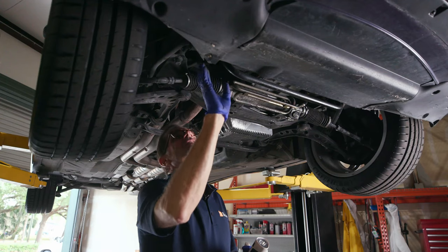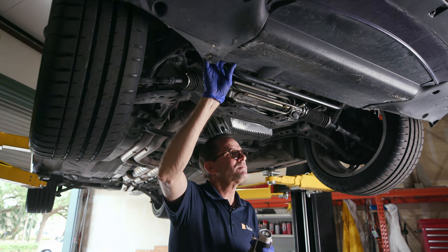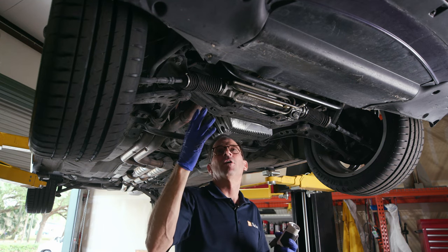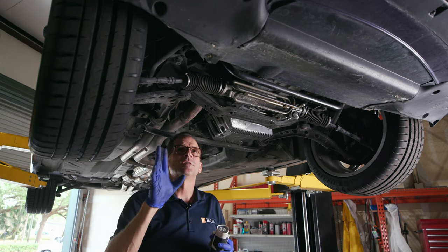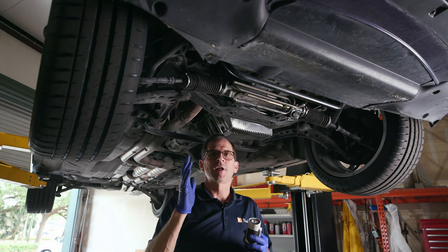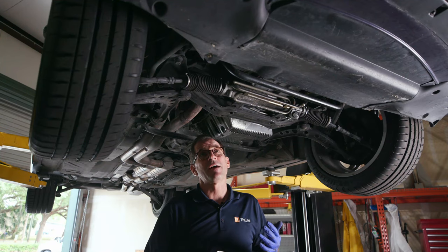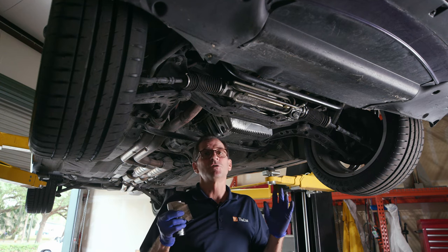All of this plastic stuff is really kind of fun to do, but also dangerous because plastic has a code on it, and it's different compositions even on the same car. So you do have to be a little careful and trial what happens on your settings and your distance and your motion to make sure that you're not giving the plastic a different texture. And that can happen. Sometimes you can use it to your advantage and your favor, which I have done. But what I'm saying is, it's not a magic wand. It's not flawless and perfect. You can screw stuff up.